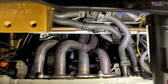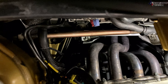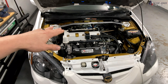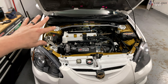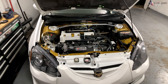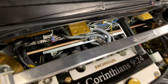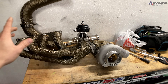As you can see, we have the Skunk 2 Alpha 4-1 down there. Now in order to remove that, we will need to remove the oil filter — that makes it a lot easier to get the Skunk 2 Alpha out. So when you're working with these 4-1 headers, keep that in mind: removing the oil filter gives you a little more wiggle room. Be careful not to break your oil pressure sensor, because I actually did that, so I actually need a new oil pressure sensor. We're going to go ahead and get the Skunk 2 Alpha header out of there and mock up the Jack Spanier Racing manifold.